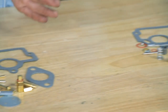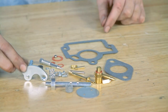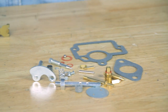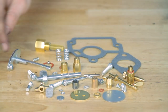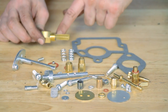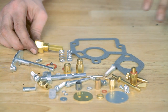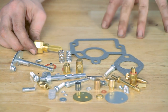Even better than that is what we call the complete kit — you get both the throttle and the choke shaft, as well as a new emulsion tube and other pieces. In this video, I use the comprehensive kit, which comes with the new butterflies, choke and throttle shafts, a plug for your drain, a new fuel inlet with a screen, and lots of nice pieces. If you want to do a very thorough job on your carburetor, this is the kit you'll choose, and I'll show you in this tutorial how to put every single piece in.